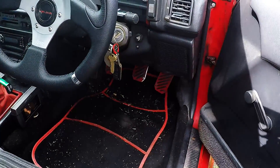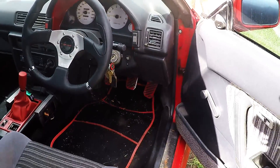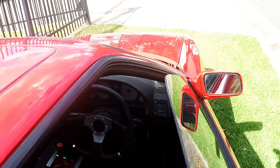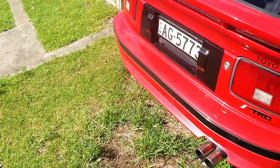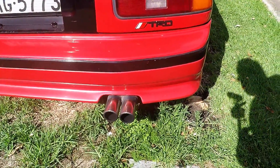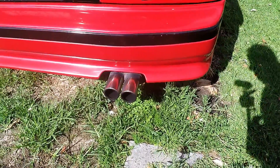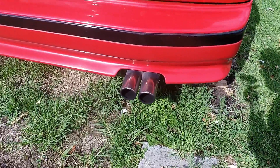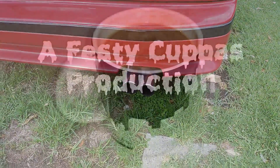It's only been gone for maybe 90 seconds, not even two minutes, and she's dropping - it's down to about 1100, maybe 1200 RPM, so it's kind of changed the attitude a little bit with the ECU as well. You can hear it's not fully warm yet, but the exhaust is actually a fair bit louder, more defined, more crisp than before, and you can hear some of that lumpiness starting to creep in.